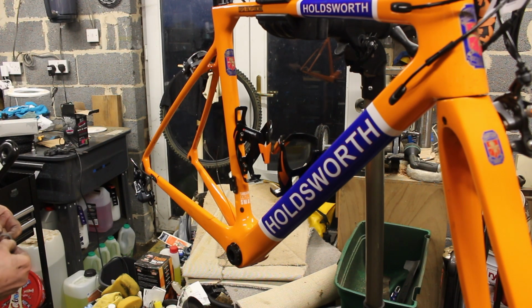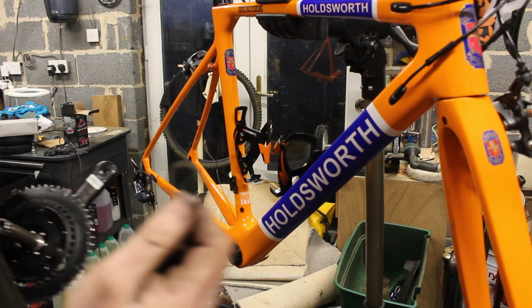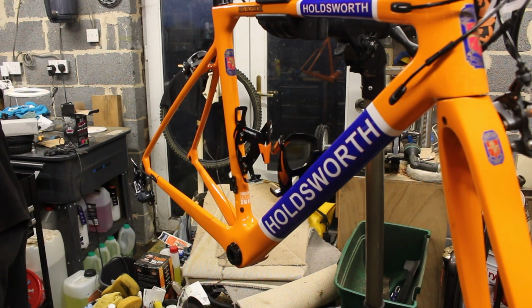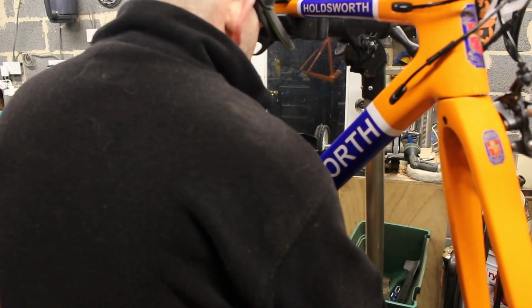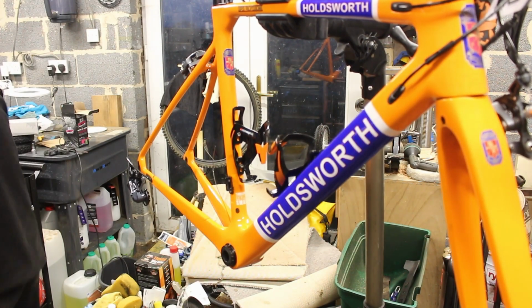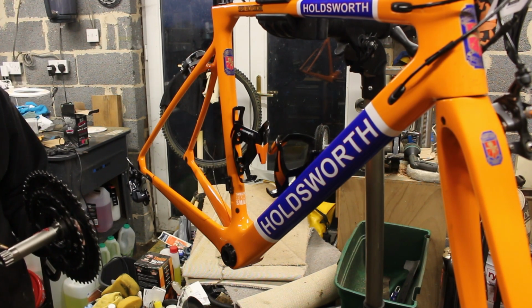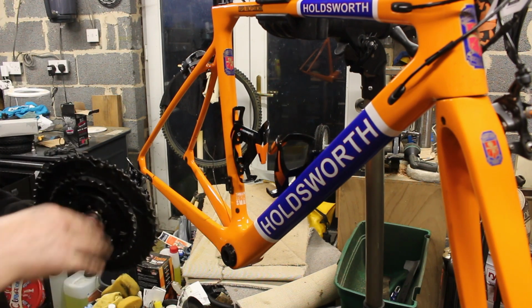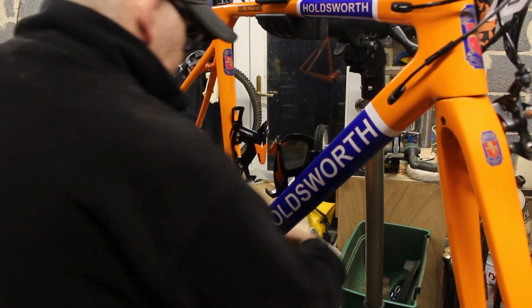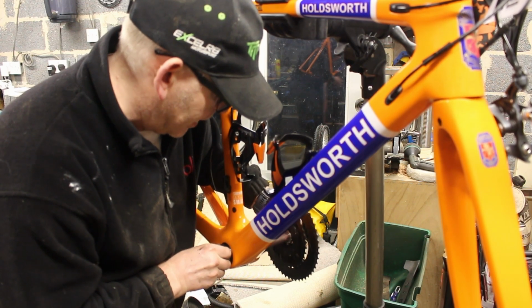Right, that's an MS318, and I know that an MS318 is a packing piece. So it's not a wavy washer, it's a packing piece. That's the wavy washer. Now it says we shouldn't need that, and this should just go straight onto there. But we will put some grease on it. Red grease everywhere. Some in the middle of there. Shouldn't really pass that through the frame in case I catch the frame. But it's my frame.